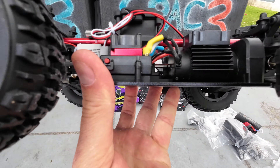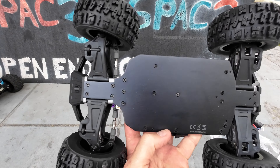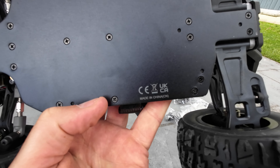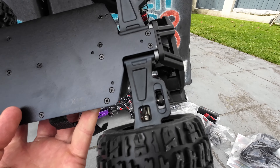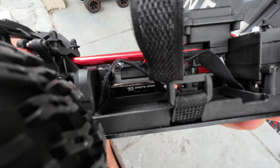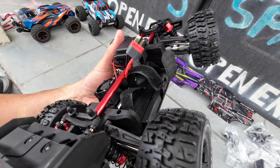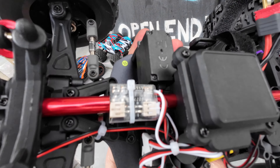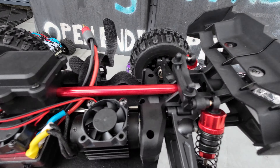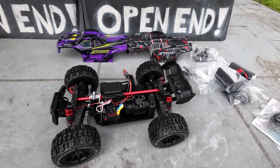There are a lot of plastic parts, and you've got an aluminium chassis — probably about 2.5 to 3 mm thick. Unfortunately there are no hex hardware screws; it's Phillips screws all the way around, which isn't a real deal breaker but worth noting. The motor is a 4400 KV BL2852, described as an 'Angry Snail' motor. You've also got your receiver box, the lighting system power connections, a waterproof servo with a servo saver underneath, and a center chassis brace to absorb jump impacts.